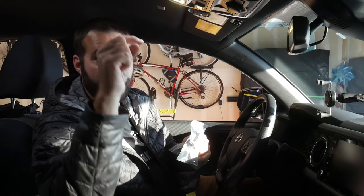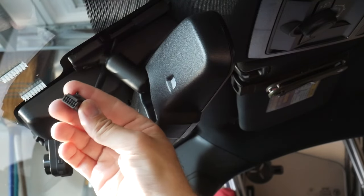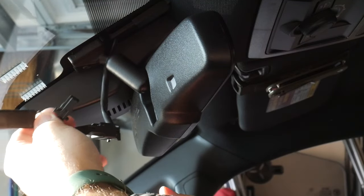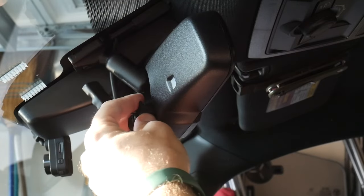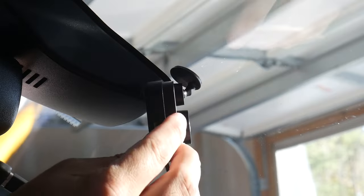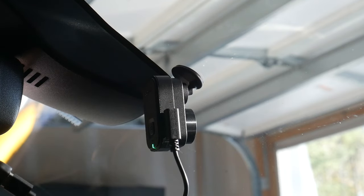If you're looking to pick up any of this stuff you see in the video, I'll put links for all of it down below. Look to the back of your rear view mirror — you have a 12-pin connector with a clip on the top. Simply push the clip down and pull straight out. Take your dongle, take the mirror you just unplugged, and plug it into one side. Take the other piece in the middle of the two connectors, which is going to go right back into the mirror. You can see this little part with the two pieces sticking up — simply clip that in. Grab your short USB cable, plug the USB side into the dongle, and on the other side of your camera is your power port. Take the cord, face it downward, plug it in. Then either start your car or run electricity to the dashcam where it starts flashing.